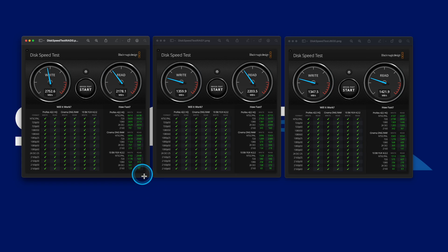I thought I'd show you some of the expected speeds you may get depending on your system and what OS you're running. Right now I'm using macOS to demonstrate this and show the different speeds you'd expect out of RAID 0, RAID 1, and JBOD. With RAID 0, this is optimized for speed — you can see that clearly with write speeds nearing 2,800MB per second, and read speeds nearing 2,200MB per second. This is optimal if you're looking for the fastest speeds possible out of a dual SSD setup.